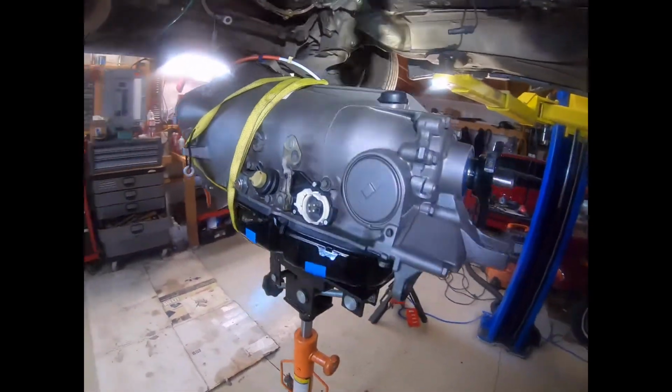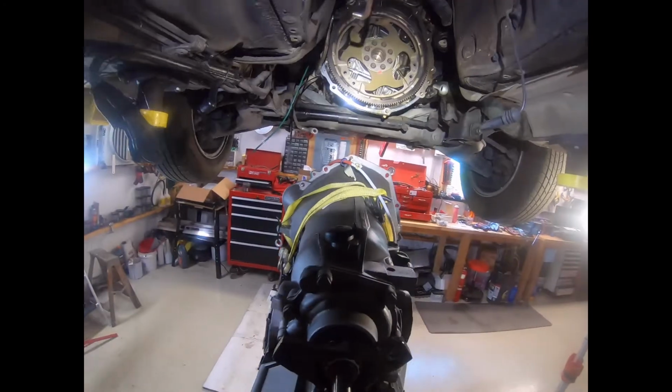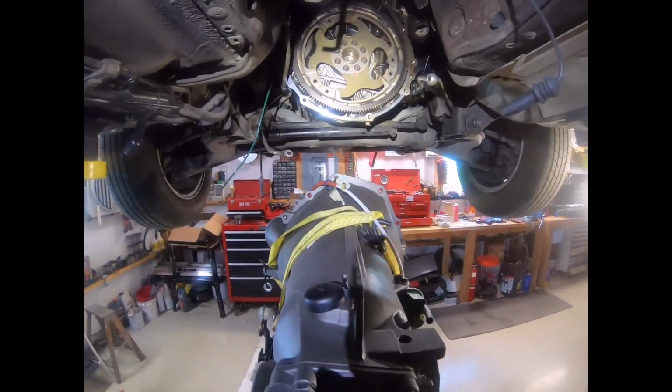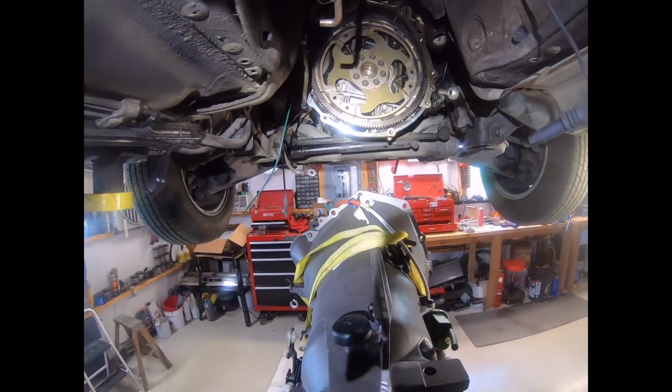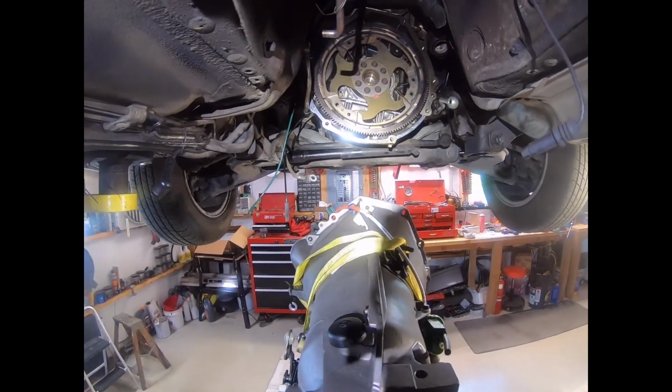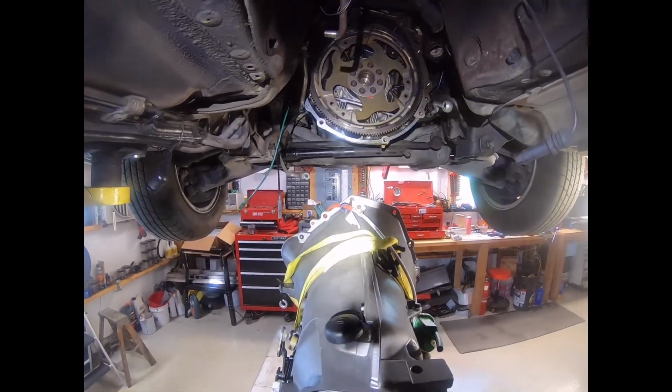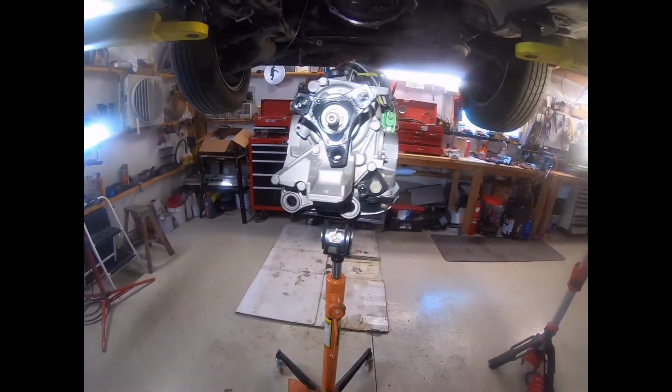Like I said previously, rear main seal was done. I reused the flex plate flywheel bolts by measuring them. They were in Mercedes spec and have been reinstalled. Tranny is all ready to go.